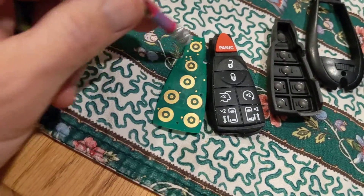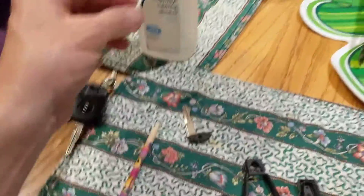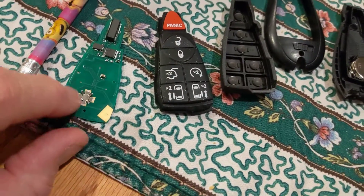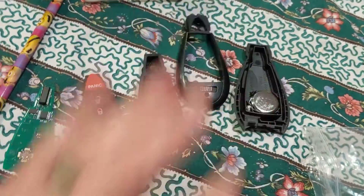What I'll do is take an eraser and rub these and get these all clean, then take a little bit of rubbing alcohol and wipe it clean. You can also double check your battery terminals and gently press those up to make a better connection on your battery.